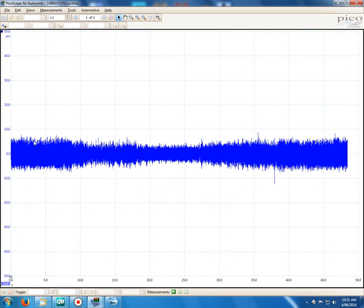And you can see here, vibration is how it started out here. This has taken over quite a considerable length of time, and you can see here that as I jacked the vehicle up, the engine up I should say, off the mounts. The mounts were all still done up. I didn't loosen any bolts, but as I jacked the engine up and took the weight, supported the weight, the vibration reduced. You can almost actually see the jacking events. If you look real closely, you can almost see each pump of the jack until it got down to its lowest vibration. And then as I slowly let the jack back again, you can see the vibration increased again. I just thought that was interesting.